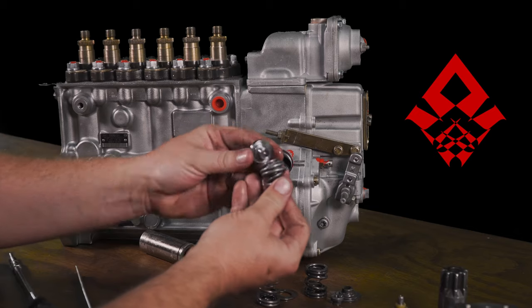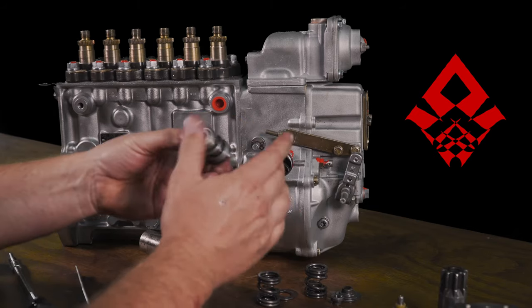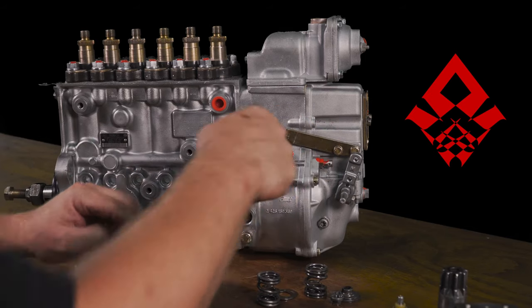I had you take this out so you don't accidentally leave this little spacer base in there. If you leave this spacer base in and put the new spring stack on it, it'll kind of halfway fit and screw everything up — your truck will not run or start well, it could run away, you could hit the housing. So once again: wear shim, idle spring, back in. Big idle springs going back in. The new Power-Driven 4K governor springs have a nice machined base at the right height and nice square-cut springs — quality parts.